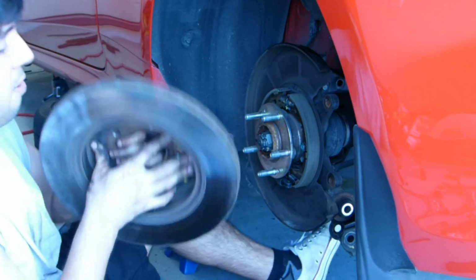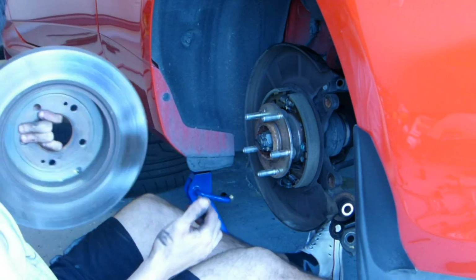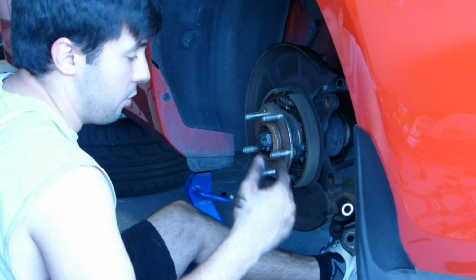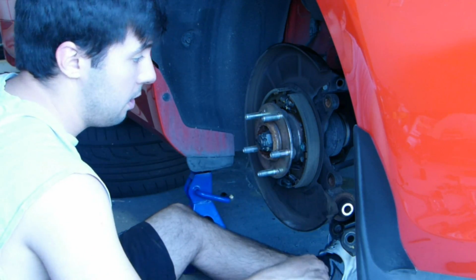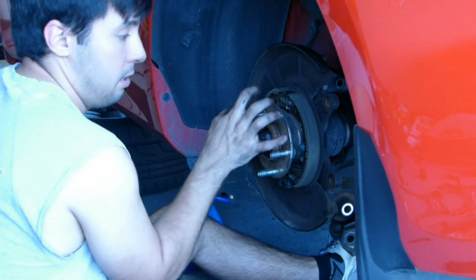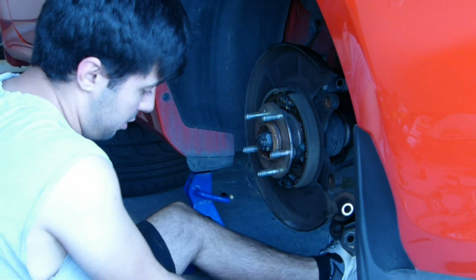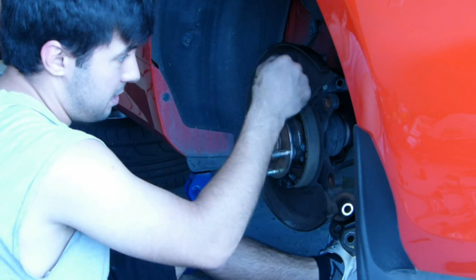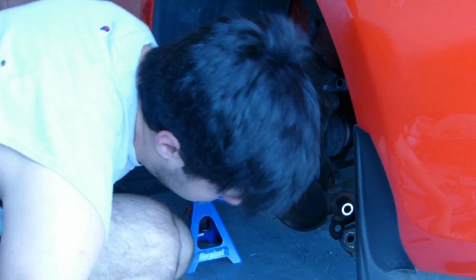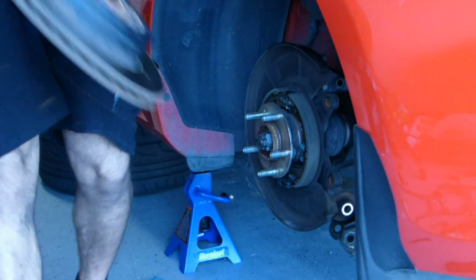You can see that again on the front. On the inside here, there's another braking surface. Now that braking surface is right here. It's a traditional or an old-fashioned drum brake. And basically, as you pull your e-brake into your parking brake, these things open up, scrapes the inside. You can see that dust in there, it's pretty gross. This dust is actually toxic, so definitely don't breathe that in. Don't give it a blow or anything like that. But now the back's off, and I'll show you how to do the front.